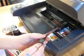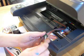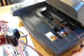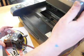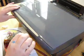The next thing we need to do — part way down the line you will see a tube clip. It can be installed here or just around the side. I'm going to remove the backing tape from this and fix it down at the side of the continuous ink system, just like that. The tube is coming down and out the side of the printer. Don't worry — when you shut the printer lid it's not going to trap it or stop the ink flowing, and you'll still be able to use the scanner and everything else.